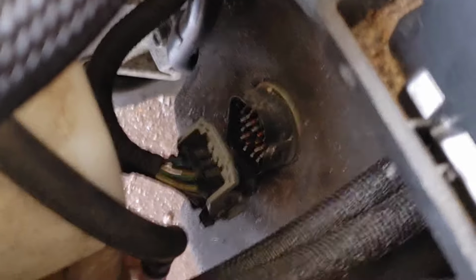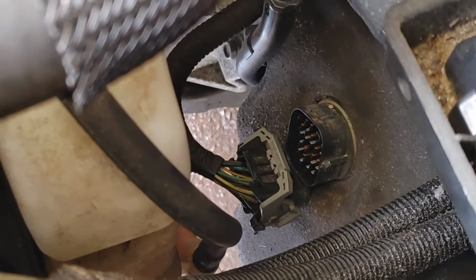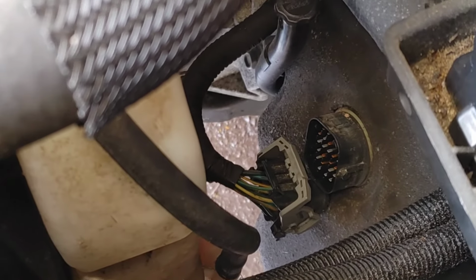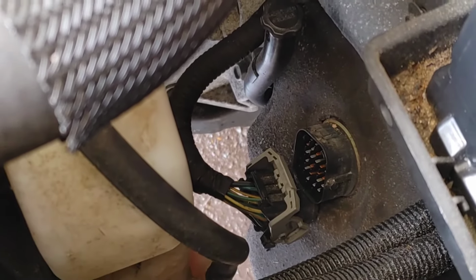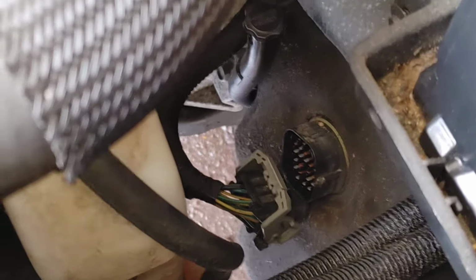You want to take your time to get this clip off. Just like I did that, you're going to move the rocker. It is going to push that plug off, okay? If anything is tied up, don't get aggravated with it. If you break that plug, you've got a serious issue. Also, you'll have to rewire that entire plug unless you want to buy a new harness, which is a lot of money.